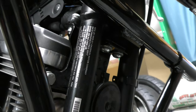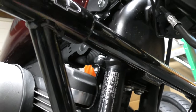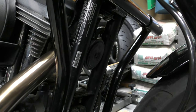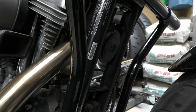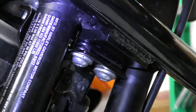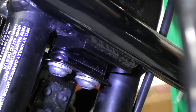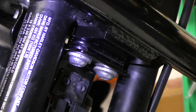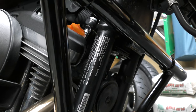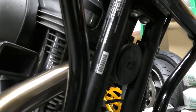I ended up pushing or grabbing the cage — what that does is push it the opposite way, so you're able to finger-thread the right bolt in. I just kept going back and forth: release, let the zip tie pull it tight so one side lines up, finger-thread it, grab the cage, then finger-thread the rest on the other side. Then you can just ratchet them down and torque them to spec without really having to fight it. If you have two people, one can just pull the cage whichever direction it needs to go. Note the order of things: horn bracket and stabilizer link first, then the cage, then the frame. Put the horn back on when you're done.